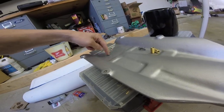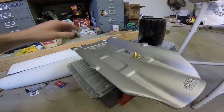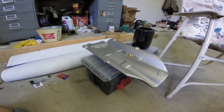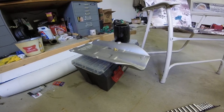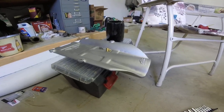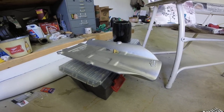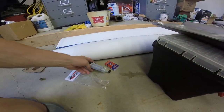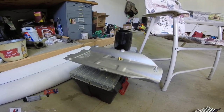Unfortunately I put a couple e-box caps that were machined from Jetski CNC — didn't realize I still had oil on them, so it stained the ride plate, but you won't see it anyways. That's the hull insert replacement — not too difficult. Go to WatCon, it's under body and hull or something, and then it's just the 550/440 hull inserts. Get some of this epoxy and your 7/16ths tap and you'll be good to go to put your fresh inserts in.